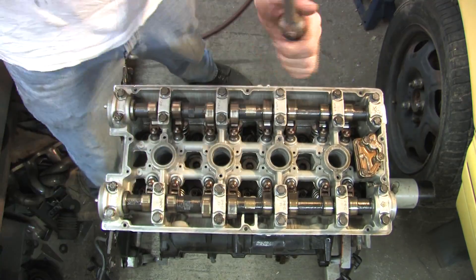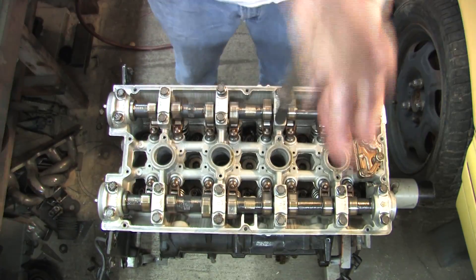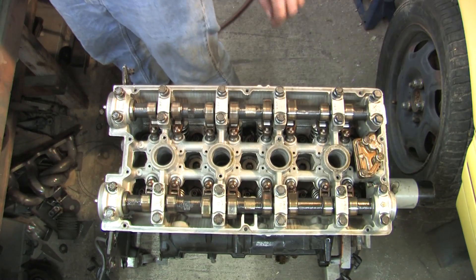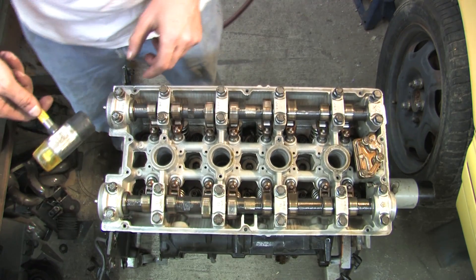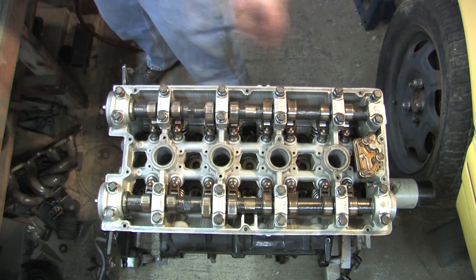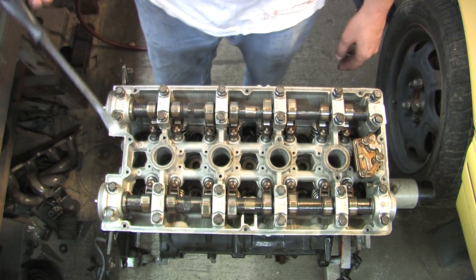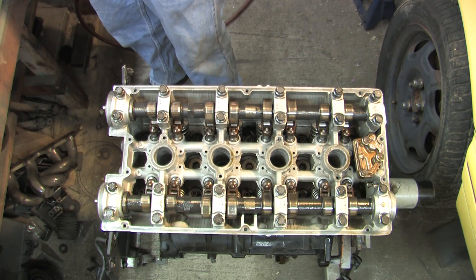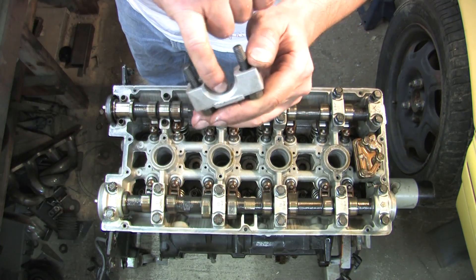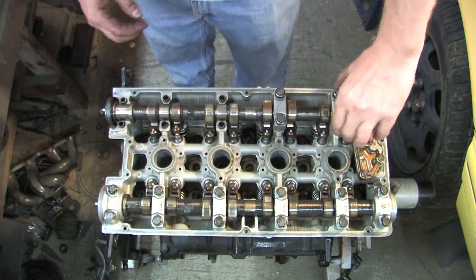I am just breaking them loose first. They have already lifted up — I am happy about that. This one has sealant on it so it usually puts up a little fight. If a cap puts up a fight there is a little edge underneath that lip where you can take a pry bar and lightly lift to dislodge it. As you remove each cam cap, scrape your fingernail across the journal of each cam cap and also the cam journal. A light groove or two isn't a deal breaker as long as both surfaces aren't wiped across their faces. Damage results from metal shavings being pumped through the oil supply, because high spots develop from metal being embedded inside the journals — that does the most damage.